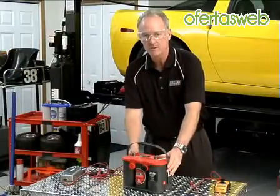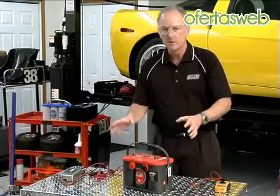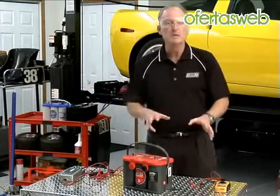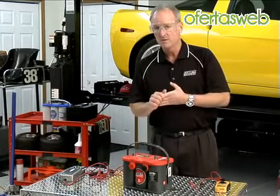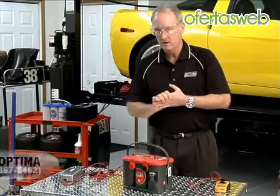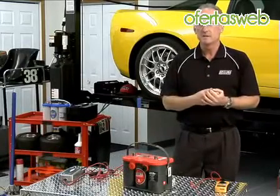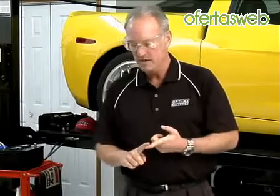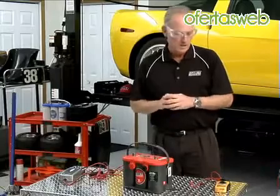If you choose not to invest in an AGM-specific battery charger, or don't want to fool around with taking a battery out of your other car and hooking up jumper cables, and you don't have a traditional battery charger or voltmeter — there's a tremendous amount of battery specialists out there that can perform this service for you. We'll be happy to refer you to one if you call our toll-free consumer service line. So there are three tips for recovering deeply discharged batteries: first, the parallel setup; second, an AGM battery-specific charger with recovery mode; and third, take it to a battery specialist.